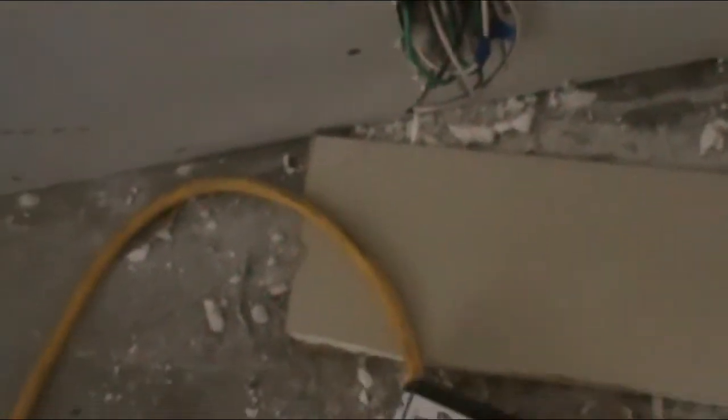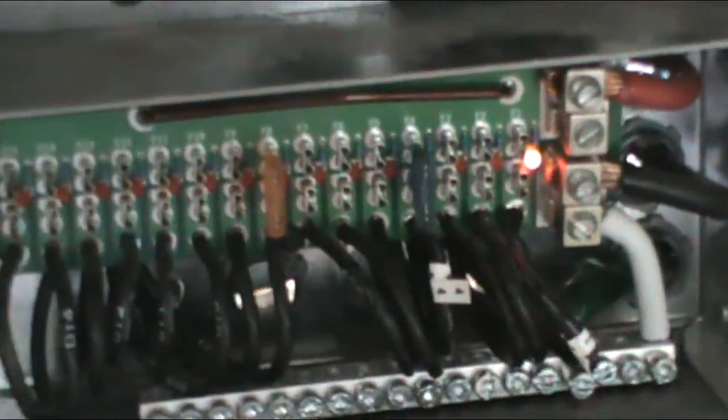The sink is going to go here, and we've got a 12-volt outlet for the 12-volt cooler and an extra. These are both dedicated outlets, and then there's a 110 down there. The water heater is both electric and propane, so its connection goes into here. I've got my panel here mainly wired — these are all 12-volt circuits down here, and the 110 is up here.